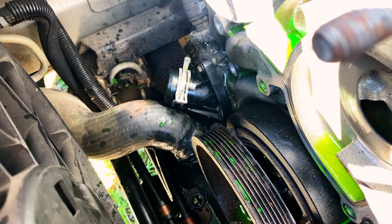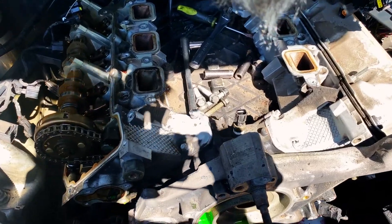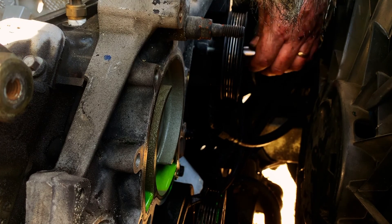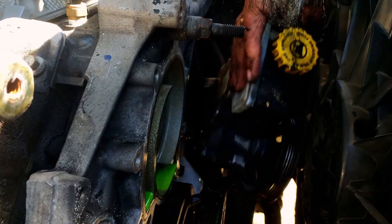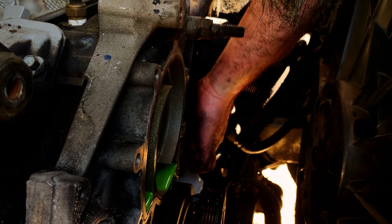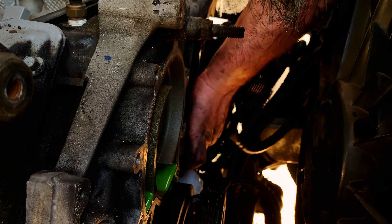What are the odds that's it for this big panel? I'll bet this goes behind the crank pulley, so I'm probably going to have to pull that off next, which is going to be fun. I don't know if I need to remove the power steering pump, but I guess we'll find out. How do I get this out of my way? Looks like it must have been a cam position sensor, and it is so greasy I can't even find the clip on there to unplug it.